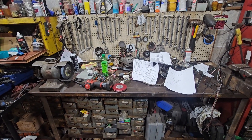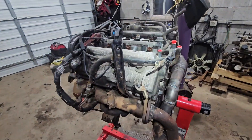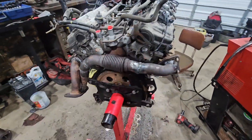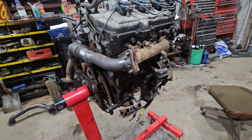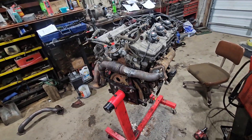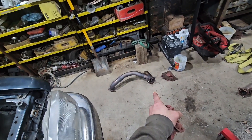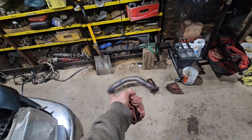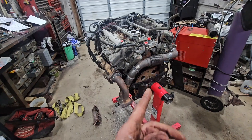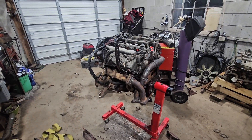I'm gonna continue on the wiring harness and hopefully get that wrapped up tonight or tomorrow so that can go in, and then it's just a matter of putting the engine in. I blew the manifolds off right away just to make sure the other ones fit. My buddy at the parts store ran the gasket year range and it was 95 to 04, so this motor being an 02 just has a different style flange — it's just rotated a different angle with a single port over here.